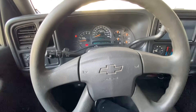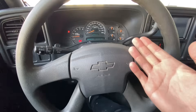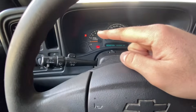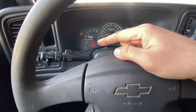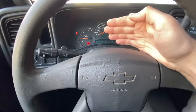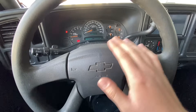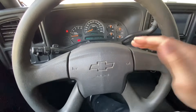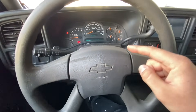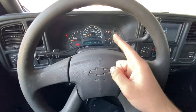With that being said, I appreciate you watching. I hope this is helpful. This is going to clear faults that are not present anymore. If there's an active problem — like my airbag here, you can see there's still a problem — the light is going to remain on until I actually fix that problem. This is only to clear the values, clear the faults, and start over in all the control modules in your vehicle. Please give it a thumbs up, subscribe, and I'll catch you in the next one.